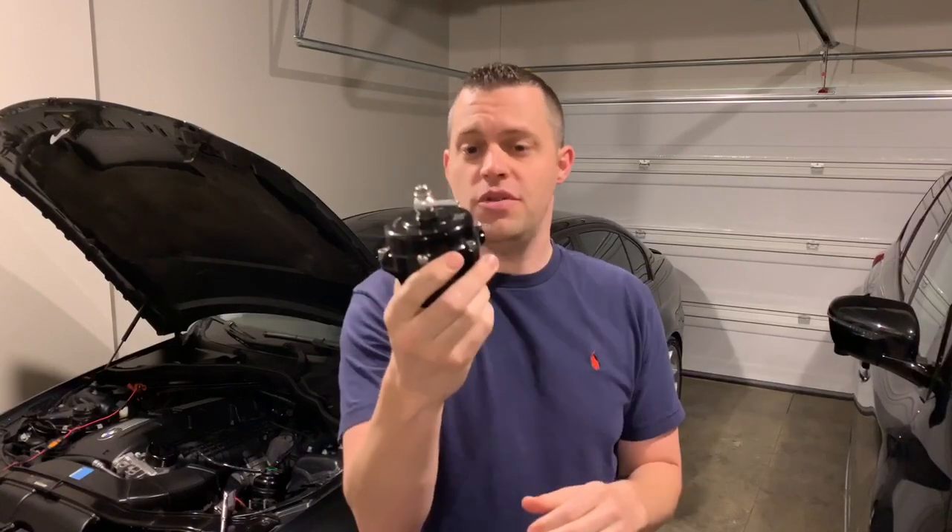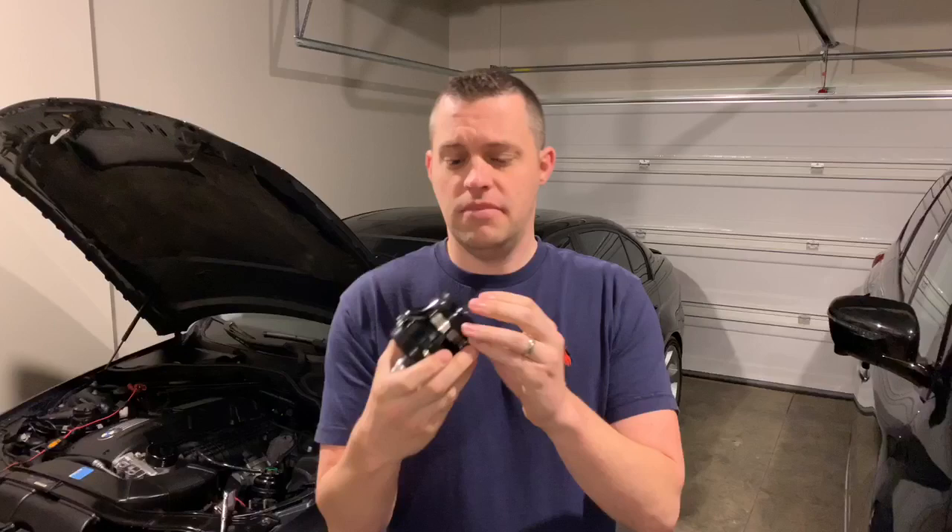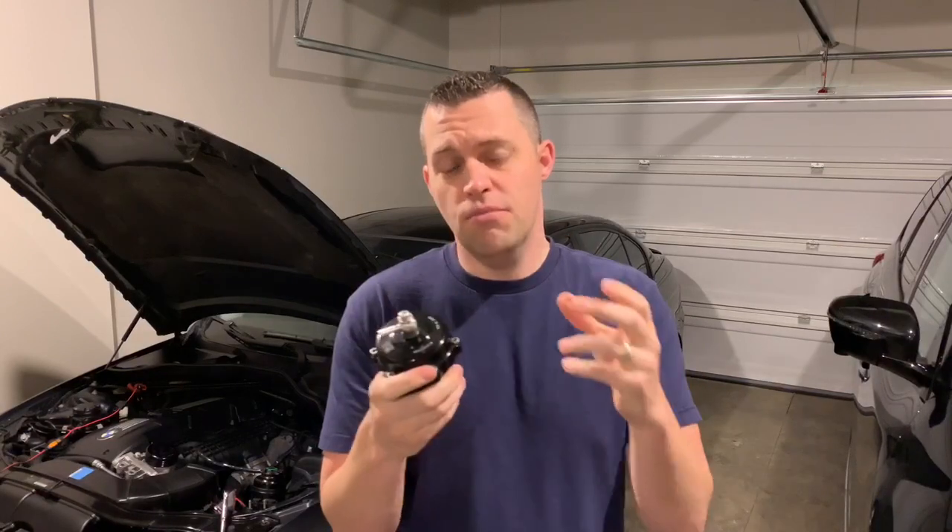Since it's a new unit that I've been using for about a couple months now, I want to show you guys how to disassemble it. I'm going to check the piston, ensure that I do have the yellow spring in there — the 11 PSI one — and I'm going to put some additional grease in there just to make sure that piston's moving freely. Because a lot of these will just sit on the shelf, and sometimes the piston can get stuck or doesn't move as freely as it really should. It's a very simple process, so let's go over to my workbench.